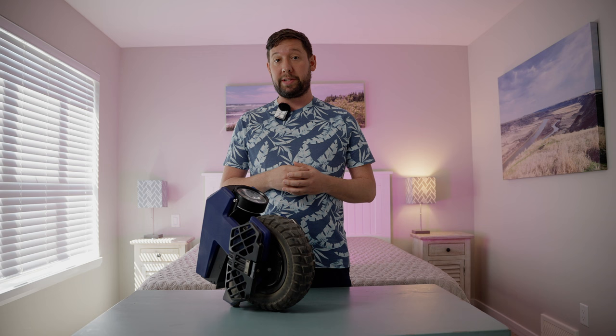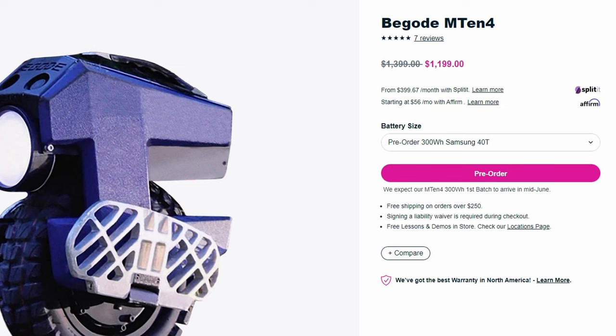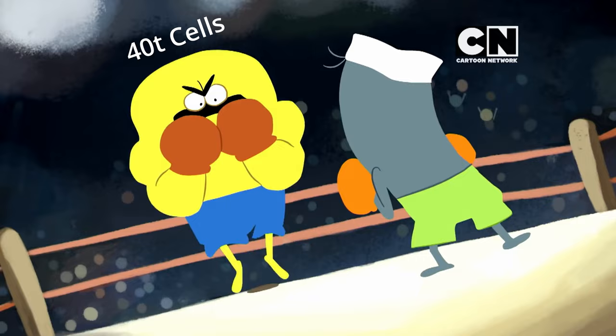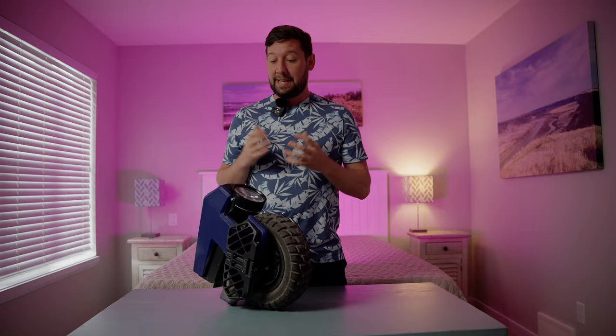This wheel is an 84-volt system and comes in a few different battery flavor options. I can currently only find the 300 watt-hour 40T and 750 watt-hour 50E variants up here in Canada, although you can buy the 600 watt-hour 40T variant in the US. The 40T cells give you more punch at the cost of range over the 50E cells. This wheel is the 50E variant, and I find the power more than adequate for the kind of leisurely riding that I'm doing.